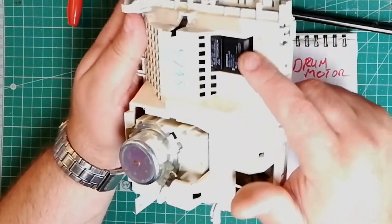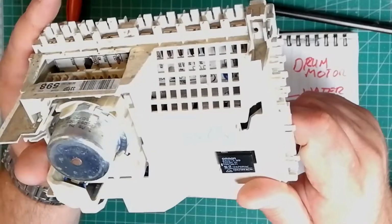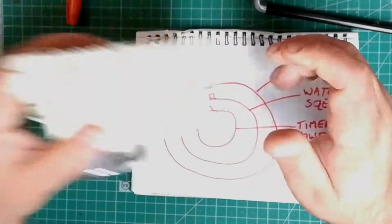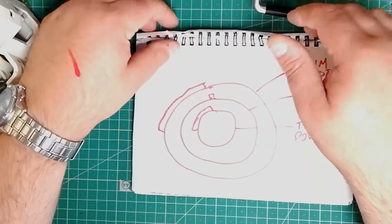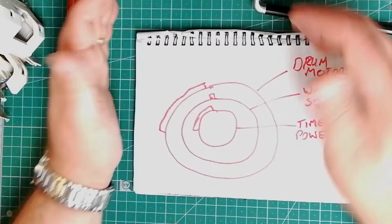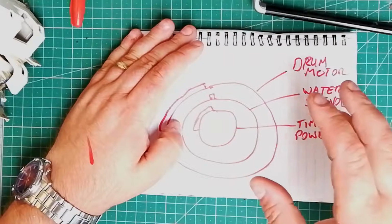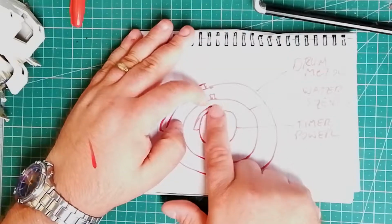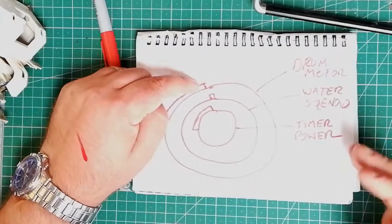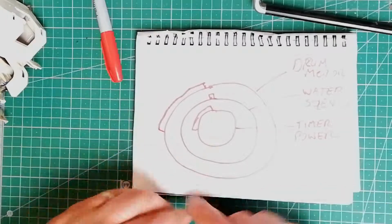and as you can see there are some relays in here, Omron relays, which are really quite good quality. What voltage are they? They're 240 volt relays, but that'll do. I can find a use for them. So that'll switch on the timer relay, and as the timer moves across one notch, the cam on the water solenoid will drop down, but then the cam that controls the drum motor, the actual rotation of the drum, will switch on, and that'll go on until another part of the cycle.